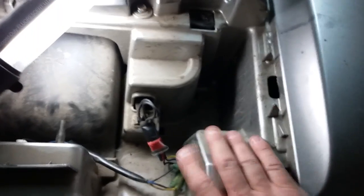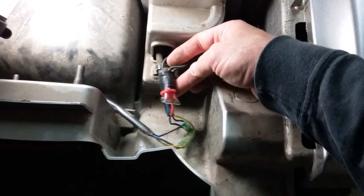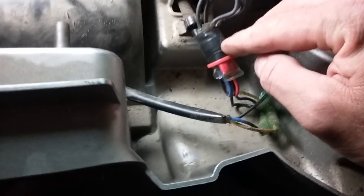All the way back here on the right side away from the muffler, they put this little guy right here, basically for cooling purposes. The reason why it's back here is so it doesn't get so much heat. But what this is, is a fan circuit breaker. It has 2 bullet connectors right here that just join onto the wire harness. It's obviously held on with a zip tie and some electrical tape right from the factory. There is basically a little circuit breaker in there. And without somebody showing you that, you probably wouldn't find it because under here, if you're looking around for that, there's barely any wires. There's just this wire, which is the same wire, but it's over by the rectifier, which runs under here. And you basically cannot see it anywhere until it pops out right there.